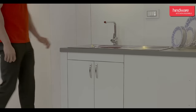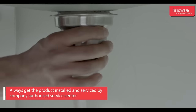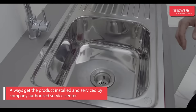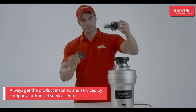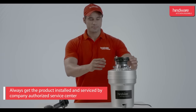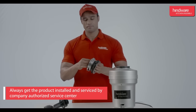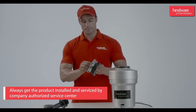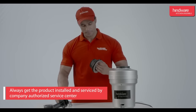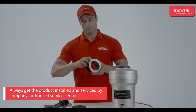Now let us go through the installation procedure. The food waste disposer should be installed under the kitchen sink. First, remove the existing drainage coupling. Then remove the splash guard and stopper from the unit, and remove the top assembly by turning the mounting ring clockwise.